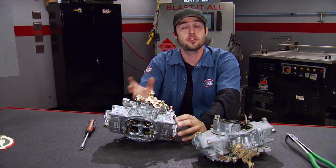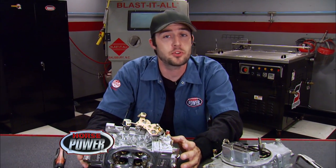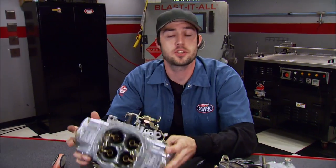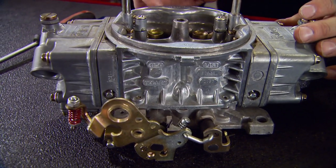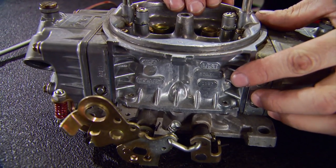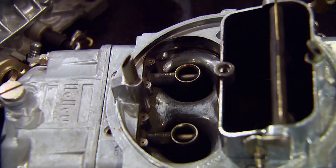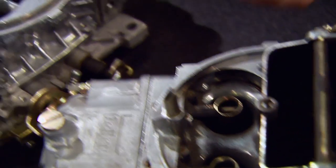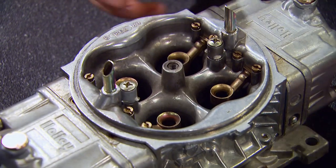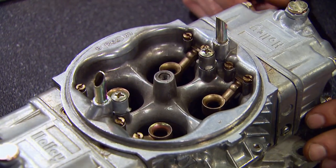Even novice gearheads basically know how their engine's carburetor works, but the more you know about what makes it work, the better off you'll be when it comes to troubleshooting and carb tuning. One of the main questions we get is: how do I identify what carburetor I've got? Each carburetor has a list number either on the side of the main body or on the front of the choke horn. Once you've got it, jump online or call the Holley tech line and they'll let you know what you've got. Holley's have two styles of boosters: the straight leg booster found on all vacuum secondary carbs, and the dog leg booster found on carburetors made for competition engines. The style of the booster helps atomize the fuel more efficiently for better acceleration.